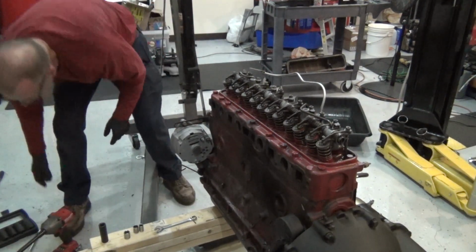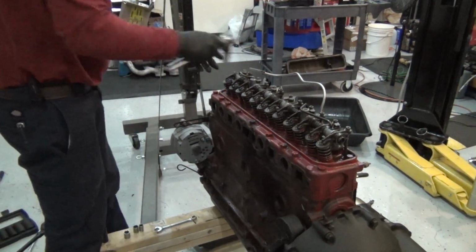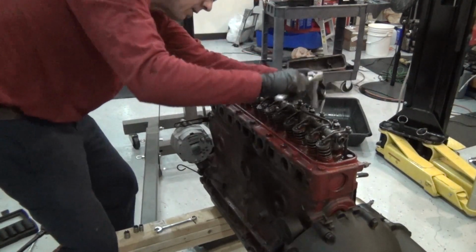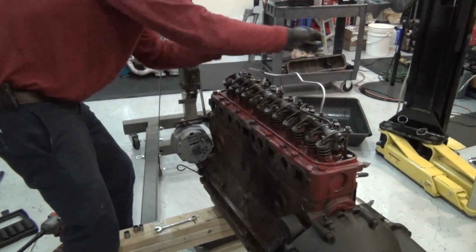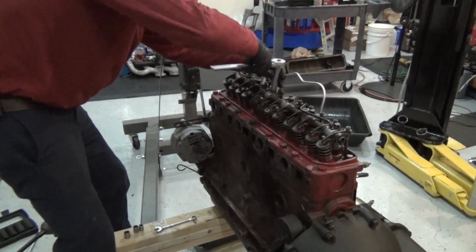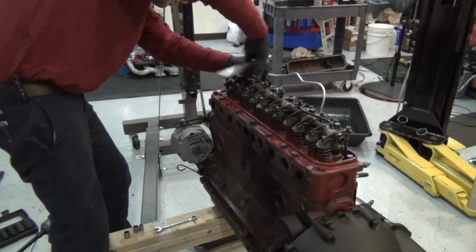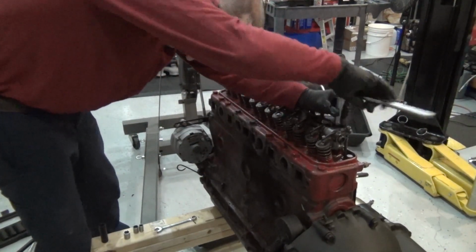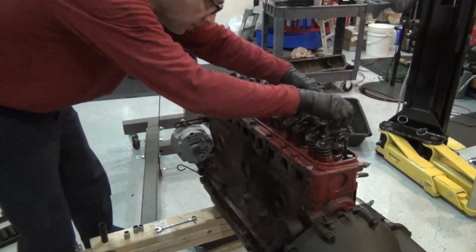Valve train. So I'm going to loosen it kind of in a pattern. This is what's recommended. You kind of come off these a little at a time, so that you're breaking that tension on it at the same time. It's got some valves depressed, so you have to kind of come up even with these. I'll come back in the middle. Give them a few more. Right here, back in the middle. Bring them all up to the top. So they're all kind of lifting. Helps get that pressure off number one intake. Alright. Now we got them all loose. Let's lift